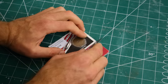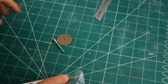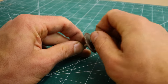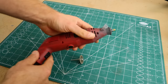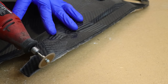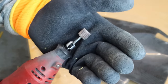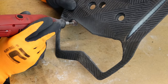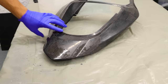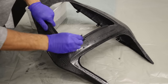Many of you suggested a diamond blade to trim around the parts, as I was using HSS rotary bits in my earlier videos. But the reason I changed was that these are quite expensive - it's actually made of tungsten, not diamond. This piece cost me 26 euros plus postage, so at the end it was 30 euros in total. After a quick assembly I fitted it to my 8 euro rotary drill - it was a straightforward process. It cuts the carbon through like it was designed to do. I took off most of the excess carbon with this tungsten carbide disc, then switched to a 49 cent sanding drum to smooth down the corners, tie bends, and edges. After all that I started sanding down the whole part with 600 grit - I did not go super deep, just wanted to scratch the top surface a little bit.